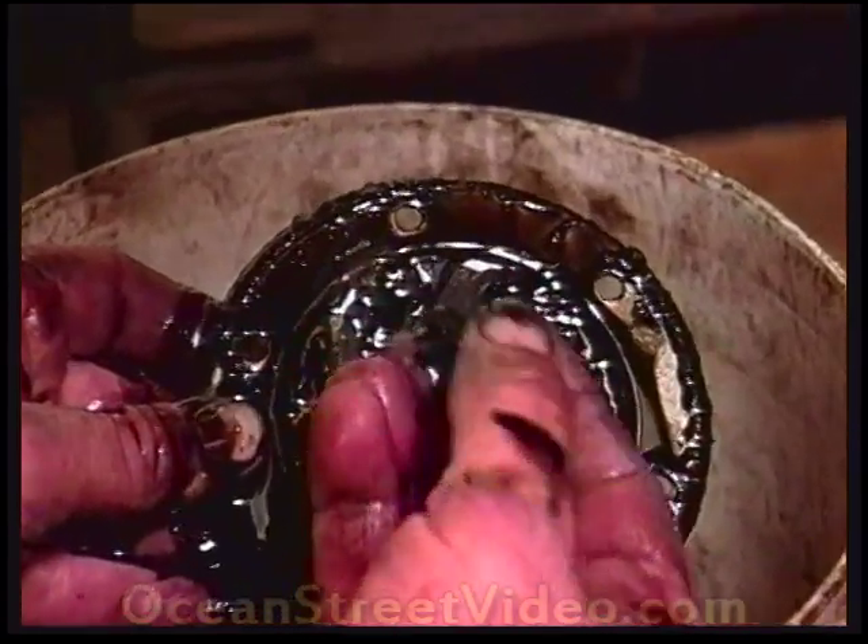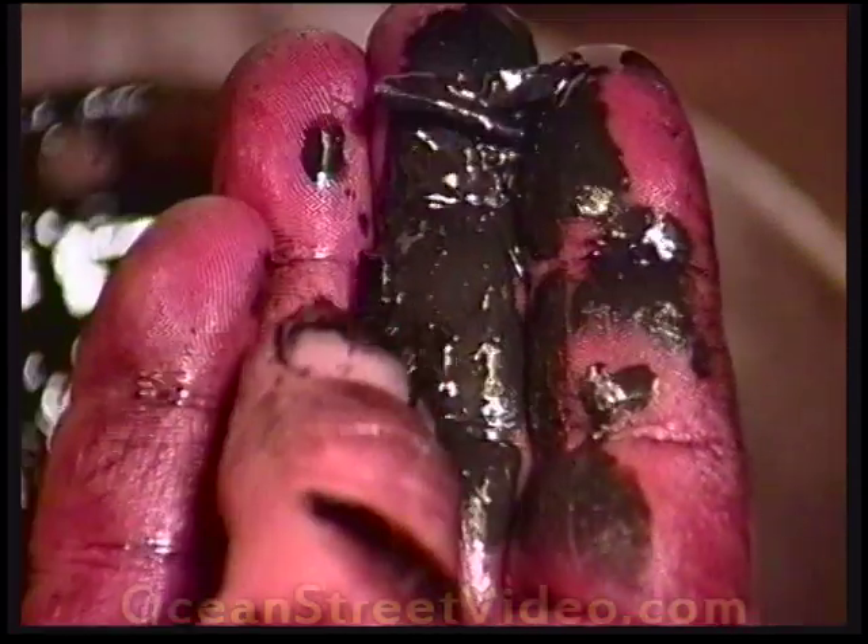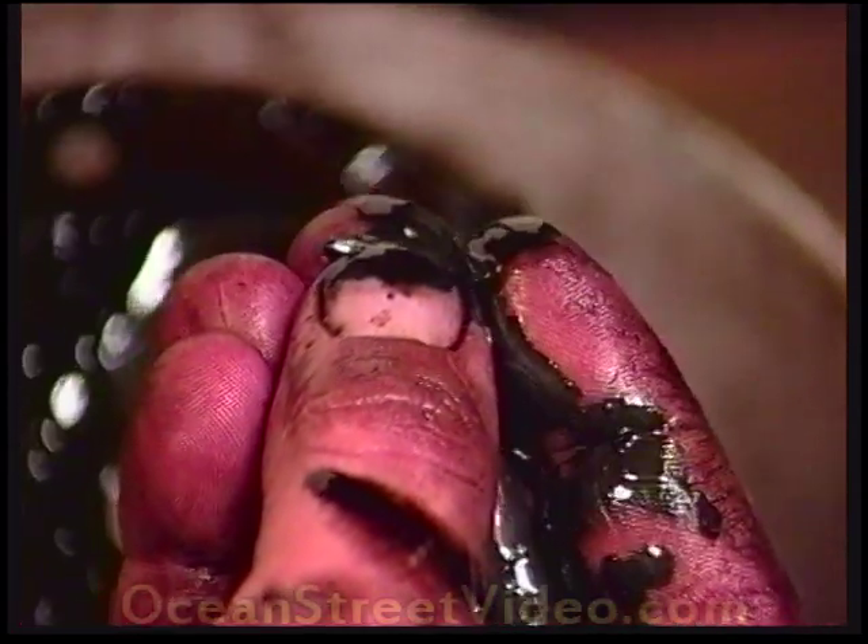We have a little piece of metal here — it looks more or less like a piece of piston. Rod bearings are usually thin and flat; this looks more like a broken piece of aluminum. Let me pull the strainer out — there should be material sitting on top of the strainer also.